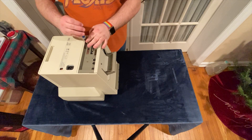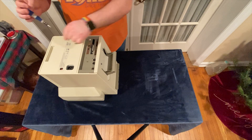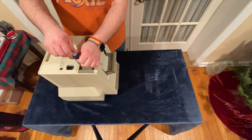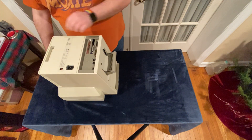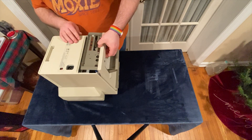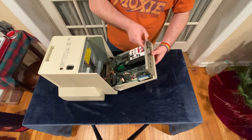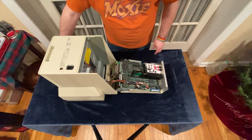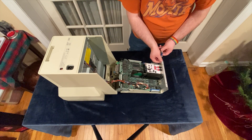If you're interested in upgrading the Model 25, you have to choose carefully, as there are only two 8-bit ISA slots available. To access them, you can open the system by removing two flathead screws at the back of the case. Then you can carefully pull the system board section of the case out, which takes a bit of finesse on my system. Once the case is freed, the system board folds down, and the cables are managed such that there is plenty of room to open the case. It's a welcome change from what we're used to with modern systems.